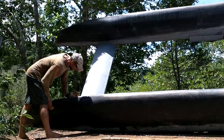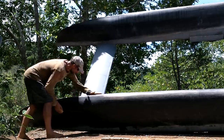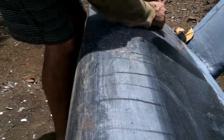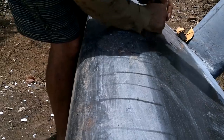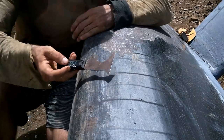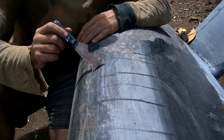There's nothing that would sink the boat or anything, but the little blisters will definitely slow things down. Don't screw that up again, Jamie. I'm having something of an issue here — this should not be coming off. I checked all the way at the other end of the pontoon and it's doing the same thing. The chances that I didn't put enough hardener in the resin over the entire thing is kind of slim, but I guess it's a possibility.